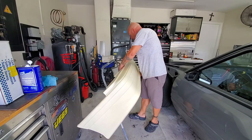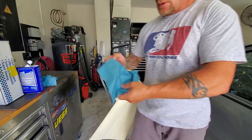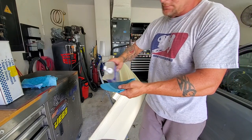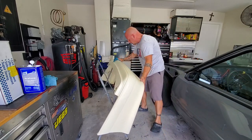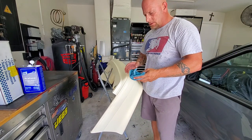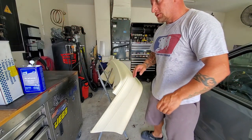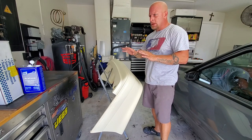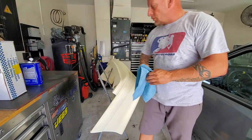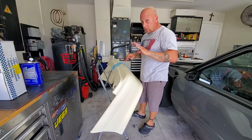Fish eyes are no joke. We're going to take another brand new towel and wipe the outside one more time just to make sure. After wiping everything down with acetone, I used a total of three rags — and those go straight in the trash. We don't use them for anything else. Those rags are completely contaminated. There are a lot of consumable items you go through when it comes to painting, and prep towels are one of them. When you use them, throw them in the garbage.